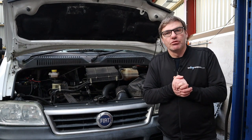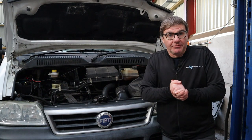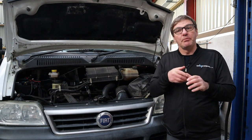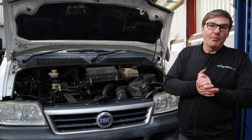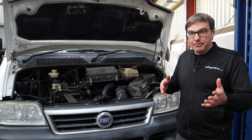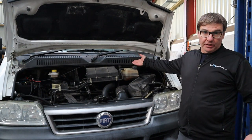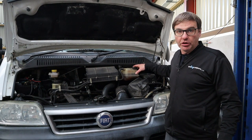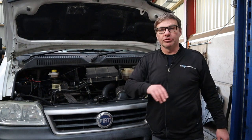One of the first things you need to do is take the motorhome or campervan for a test drive. Obviously make sure it drives okay with no funny noises or bangs, but more importantly it's more common on the Fiats and Peugeots, normally pre-2002, that second and third gear crunch. If they crunch, stay away from it. One of the main reasons why they crunch is through water ingress into the gearbox — people don't clean the scuttles, so in wintertime leaves build up, rain goes over the leaves, drops over the scuttle and then into the engine and onto the gearbox.